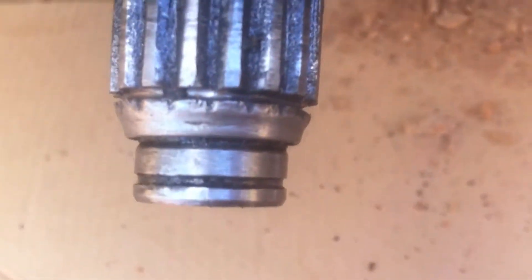I initially tried repairing this axle — sometimes you can cut a new groove in it, which I did with a Dremel. But what I couldn't see without having this hub off was that the original line for the clip is way up here. I was trying to shave off several millimeters — maybe five millimeters — and that's just not going to happen. I thought I was cutting back into the original groove.